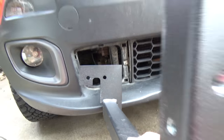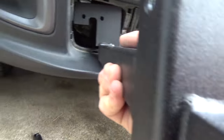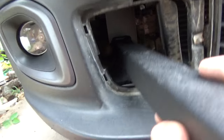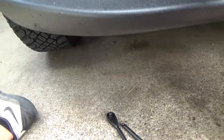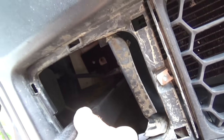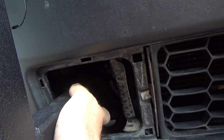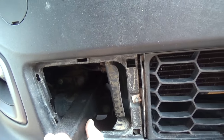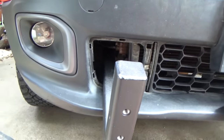Now we're going to go ahead and install this. Remember - two bolts on the front, two bolts on the outside of the vehicle. Just going to slip that into there. We're going to need to slip it underneath the radiator hose and not on top of it - it needs to go underneath this radiator hose. Then you're going to line it up with the holes and put your bolts back in and tighten them down. Then we'll get on to actually putting on the front bumper.